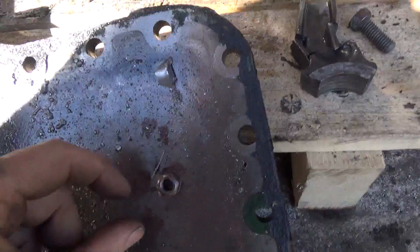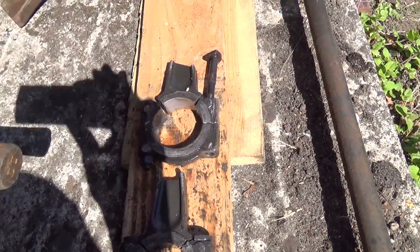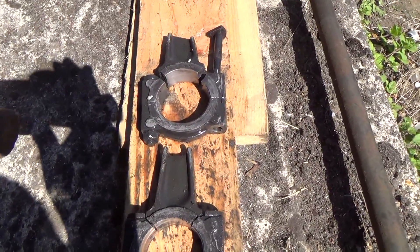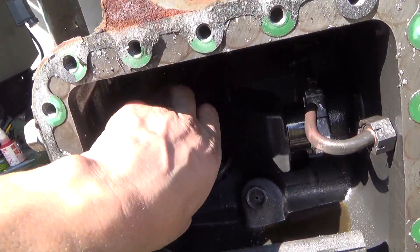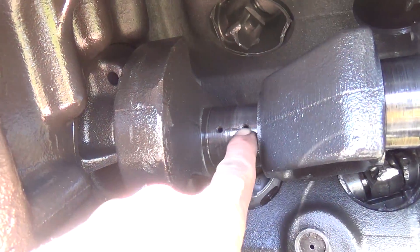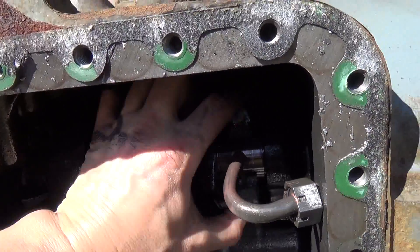What we think happened is this nut has come undone from this one here and let that go loose. We think that one broke first and then that led to the rest of them going, because as soon as one broke you've got bits of shrapnel flying around inside. Also, if it's broken off completely, it uncovers the oil hole for that particular bearing journal. So if this one let go first, a lot of the oil is going to come out of there because it's the easiest route, and then it starves the rest of them of oil.